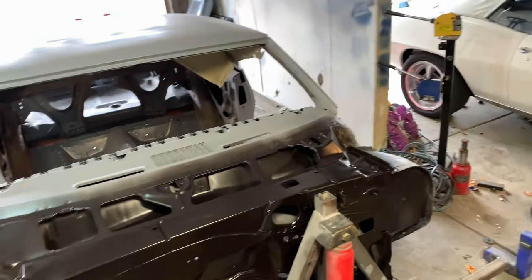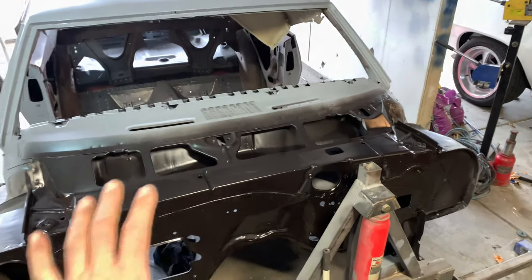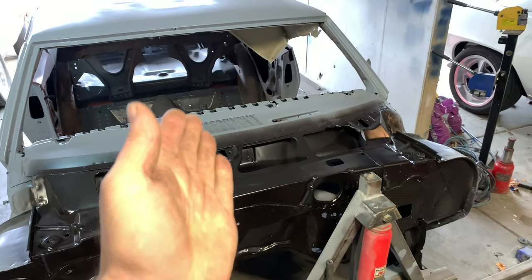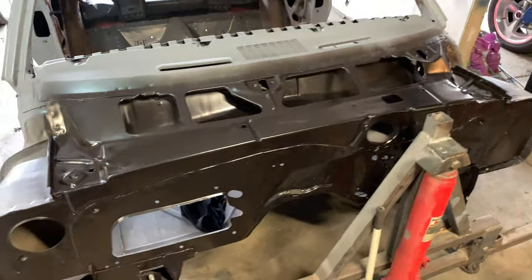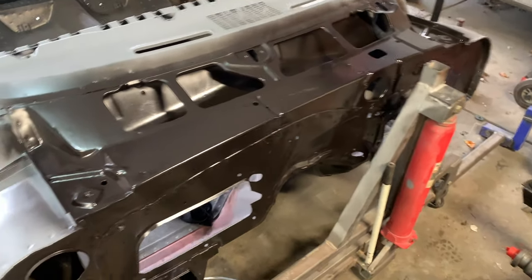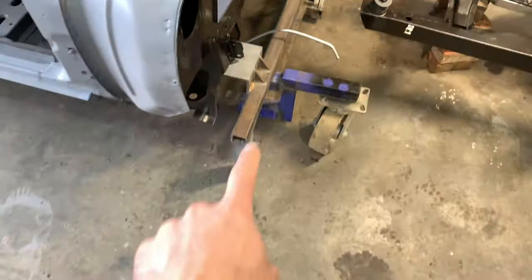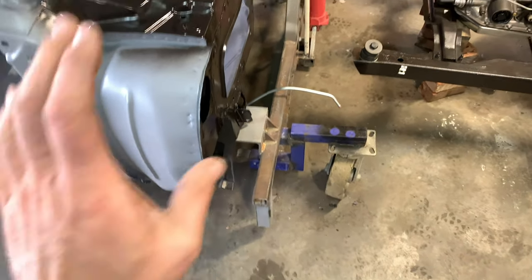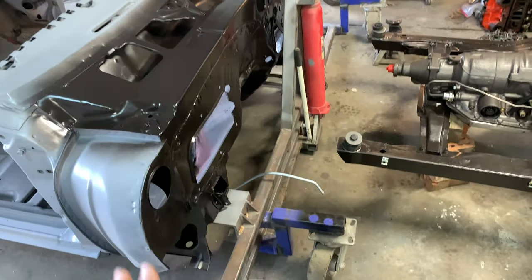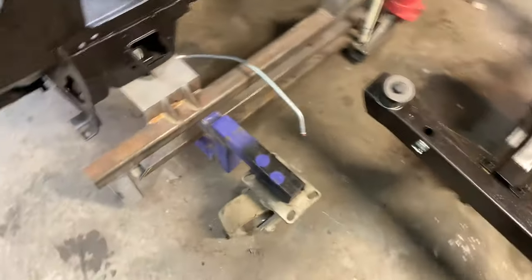The thing tips up and gets almost to the point where the cylinder's topped out, then it kind of goes the rest of the way over. Convertibles do a little better on this design — coupes are just a little bit top heavy. It gets a little close to the top and wants to flop over, so you have to kind of tug it to come back over. You could actually add a little counterweight here to offset that top-heaviness when going over the center point.